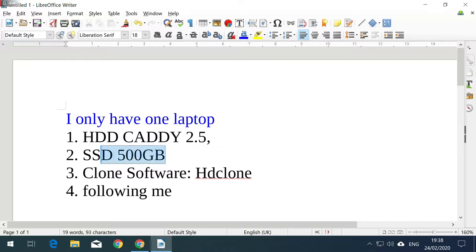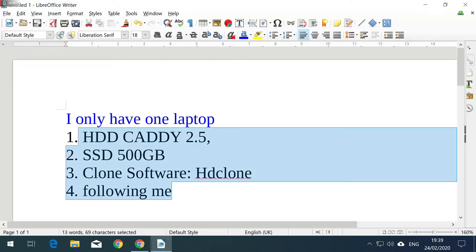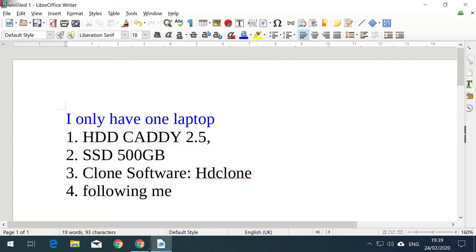And of course, you need a brand new SSD. The size is up to you. For me, 500 gigabytes is good enough for my laptop. And you need a clone software. You can use HDClone, it's quite a good one. They have a free edition that can do the job for you. Then you need to follow me to finish this procedure. It's quite simple. Let me show you.